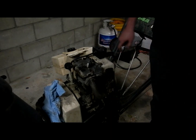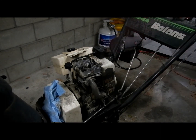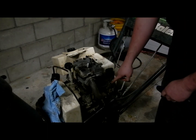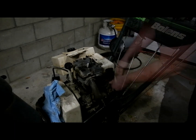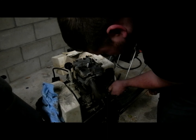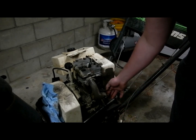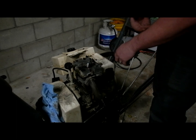I'm going to go ahead and use our Phillips head and we're going to pull this electric start mechanism right off. Now you can go ahead and take a quarter-inch — there are two quarter-inch bolts right here that hold the throttle linkage on. Don't confuse the throttle linkages: this one goes to the main mechanism we just took off, and the smaller, shorter one goes to the carburetor. It's really hard to confuse them, but just make sure you know which one goes where.